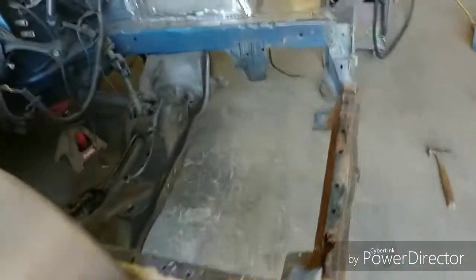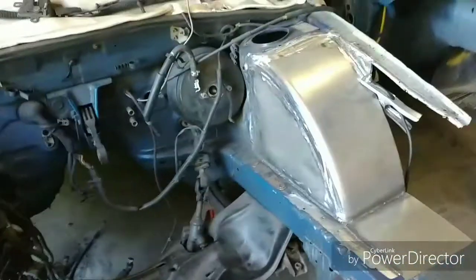As you guys can see, everything is welded from the backside as well. Grind it down nice and smooth. I use bed liner — it's the best. I don't use undercoating. I don't rely on the materials the OEM factory supplies for these cars. It rots for a reason because there is no rust prevention. You've got to get in there and prevent it. I like to seal it with bed liner so that I am past the whole rust prevention — I'm rust proof. Yeah, it's possible.